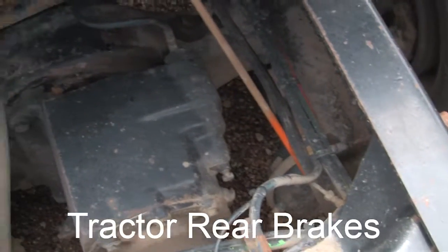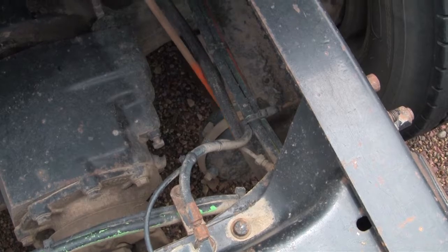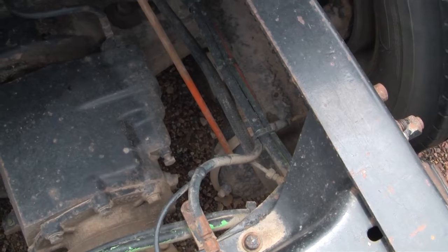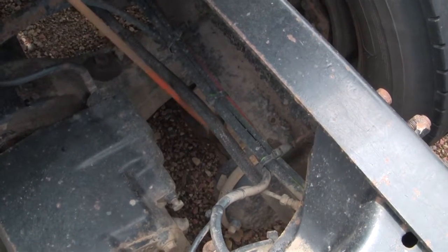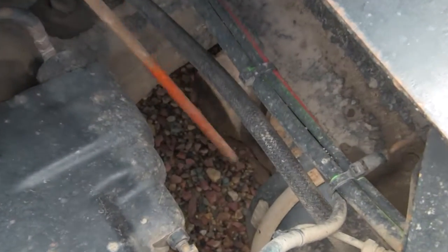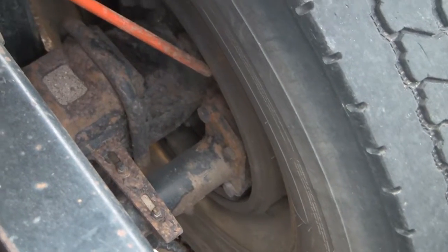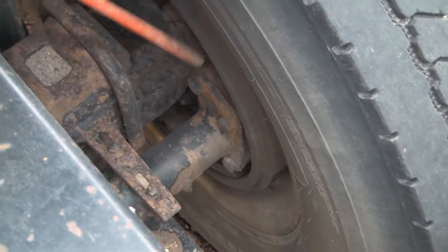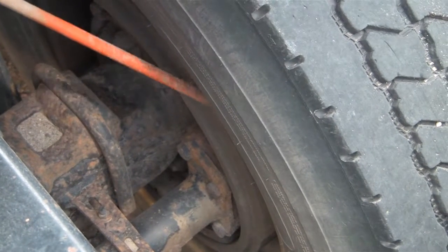On the air brakes, I check the air hoses — make sure they're not leaking. Those go into your brake chamber — make sure it's not rusting and doesn't have any non-manufactured holes. I check the slack adjuster and the push rod — make sure all the parts are there and they can't move. Then I check the linings again — make sure they have at least a quarter inch of material, no fluids on them. The drum doesn't have any fluids on it and it's not cracked or broken.